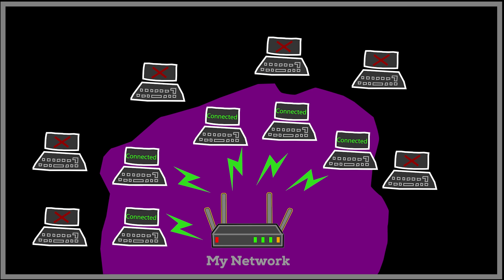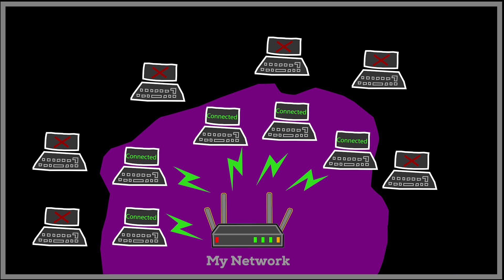Also, there is now one access point providing coverage for a large area, meaning more client devices can connect to it. However, the access point has limited processing power, and if the number of clients exceeds its capability, it can overload the access point. So we will have an access point that provides great Wi-Fi coverage but cannot handle all the new clients. This might not be an issue for a place with few clients, but in this project I know there are many clients in this building, so it is likely that I might overload the access point, which is not good.